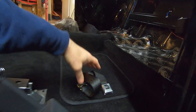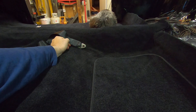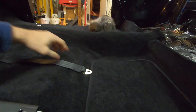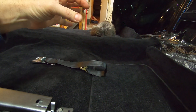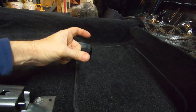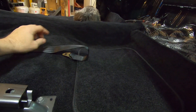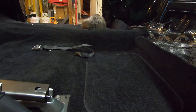On the center ones that go up in here, normally you'd drill a hole in your floor and put an anchor on the back side with the nut on it, and I didn't want that under my car. So what I did — like a lot of late model cars — is mount this to the seat itself. This will basically go across the seat bottom underneath the top, curl all the way down and under. When I tore down the seat bottom and blasted it, I put in a thick piece of plate, rectangle shaped, drilled a big hole in it for the bolt and nut, did two more holes, plug welded it to the frame and perimeter welded it — so this will actually bolt to the seat frame and come out under the seat, with nothing under the car.